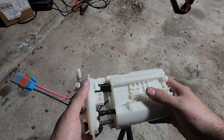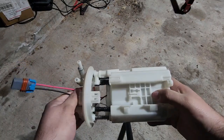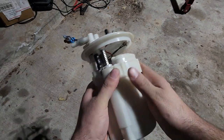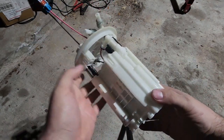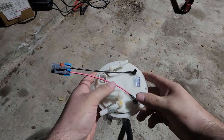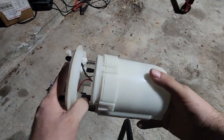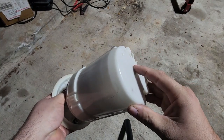These pumps, this one right here specifically, can flow, I believe the pressure switch is 135 psi, and it'll definitely flow the fuel that I need with ease. So this is my solution on how to get the Walbro 450 to fit. If anyone else has some modification that they did, I'd definitely be interested in seeing how they fit it in there. But like I said, other than people saying they have a Walbro 450, I've never seen anyone actually show how to fit them in the housing. This right here is, in my opinion, the safest way to put the 450 in there. Having that spacer is going to make sure the pump doesn't kick out, which is one of the bigger problems that I've heard.